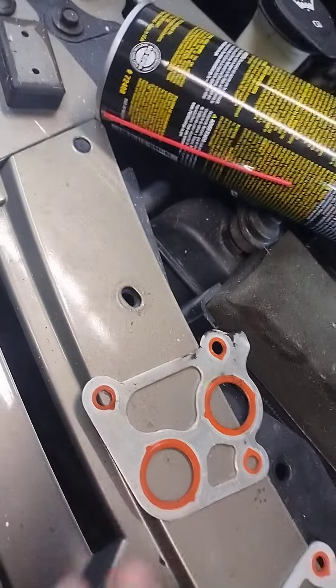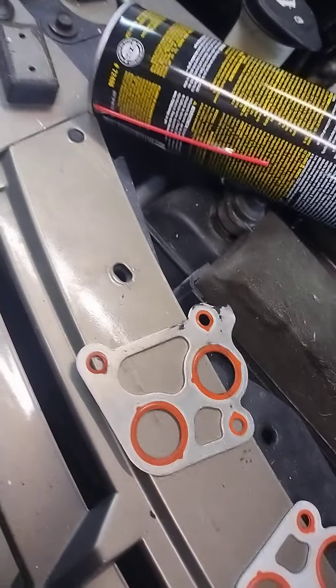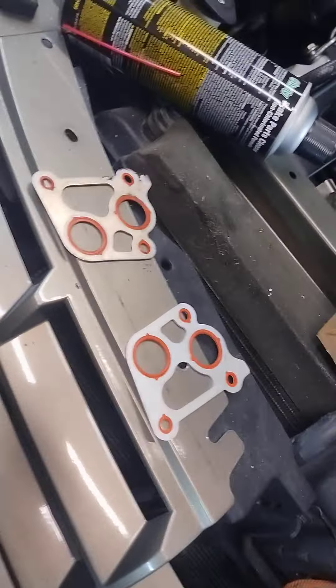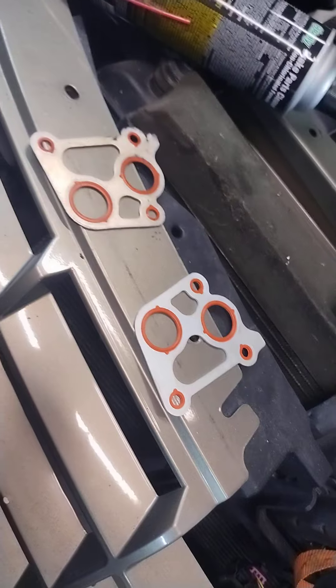Don't try to tighten it, because the block is aluminum — you'll end up stripping it and it still won't seal. I just want to give you a little tip on that one. Make sure if it hasn't been done, I would recommend getting it done, because it'll start pouring oil out, you'll dump all the oil, and lock up the motor without even realizing it — all because of that little bitty tiny lip. Anyway, thanks again for tuning in.